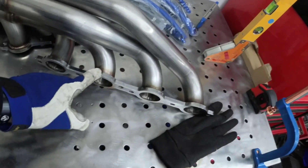That's basically how I got the v-bands to work on the outlets. As you can see there's some blood there because I smashed my hand getting these things on — that's because I didn't do the relief slices at first. I was trying to get them to shrink a little bit, heating up the flanges to get them on, and it just wasn't working.